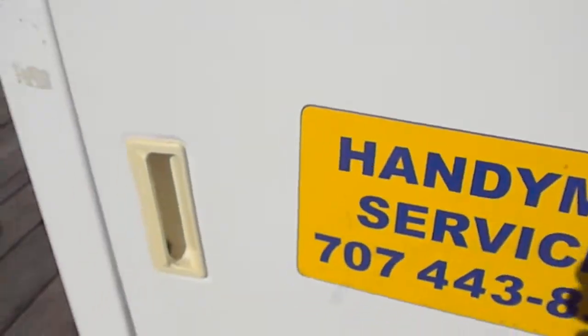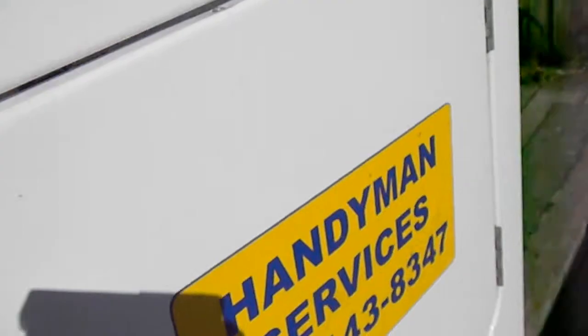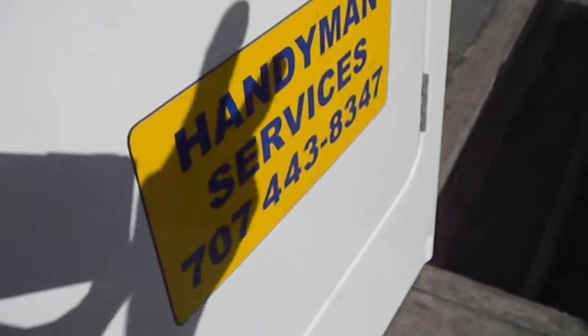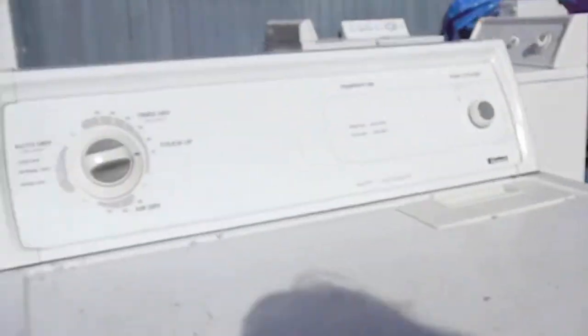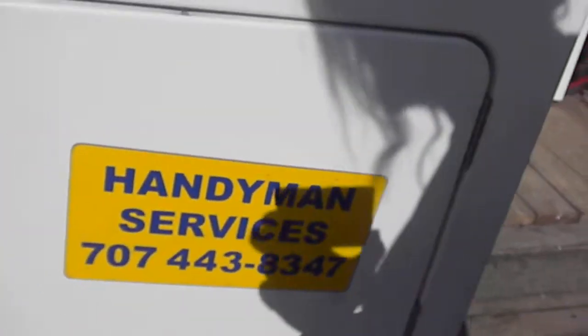Welcome to the Adventures of Handyman Services. If your dryer temperature is not up to snuff, a couple of things you definitely want to check: your vent flow — make sure there's no kinks — and check the outside of your house for vent flow issues.